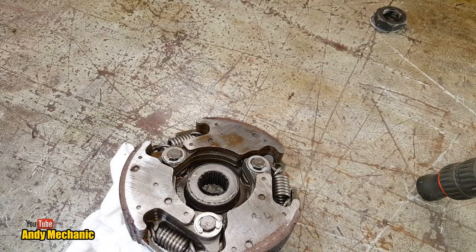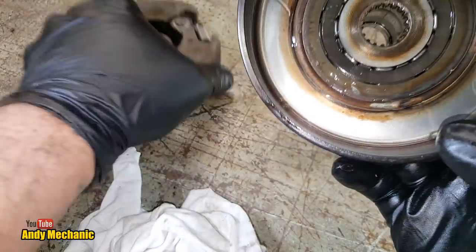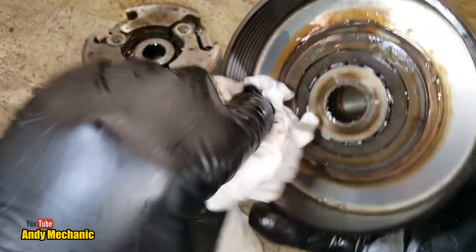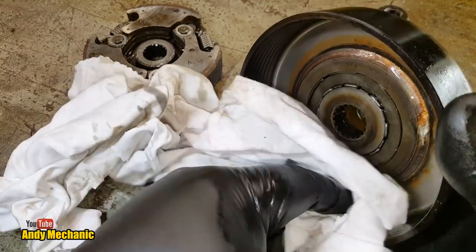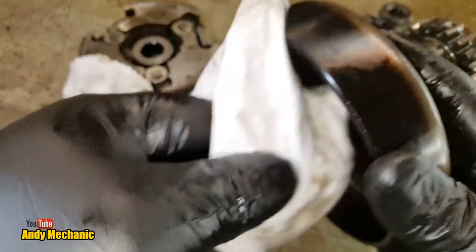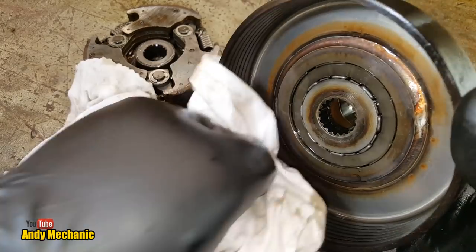Let's take a look at the drum. Jeez, torchy, not do that. Okay, stick it over there. Because what we're looking for is a reason why this machine hasn't got the drive. Because the engine was still running, don't forget. It would only drive in super low. So there's a friction problem, something's wrong with the drive train. And you can see there, look, the blackening of that drum. That's been red hot at some point, which will have changed.